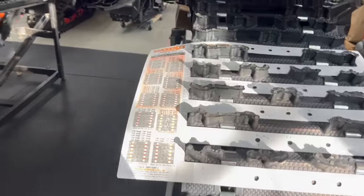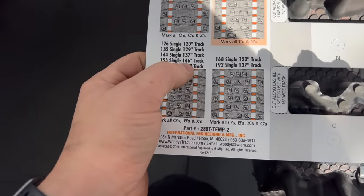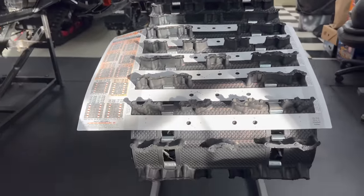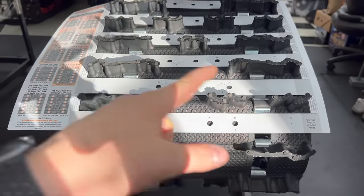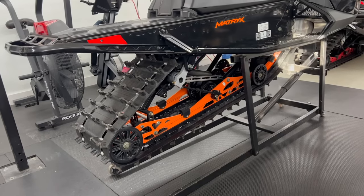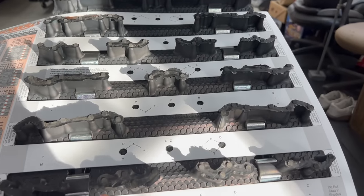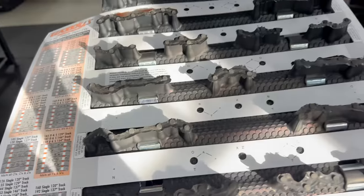Getting ready to mark. On my Assault Boost I'm doing three per window — three per lug — which ends up being 153 singles. Some guys do double singles, but Rick from Woody's recommends three singles as the best all-around performance for what we're doing. For boost applications I recommend at least three studs per row; for naturally aspirated or short track stuff, two per row is what Woody's recommends. We're marking all O's, B's, and X's and then we'll start drilling.